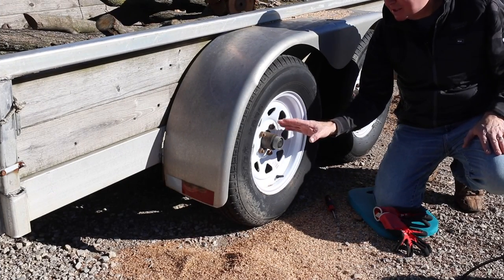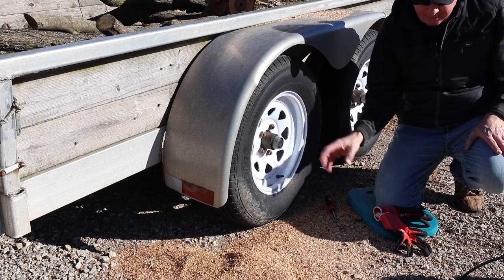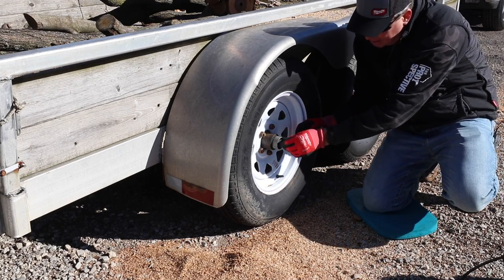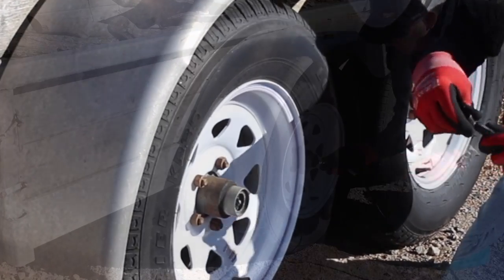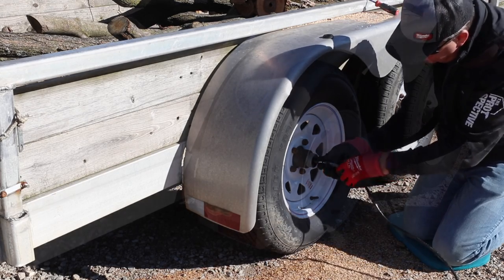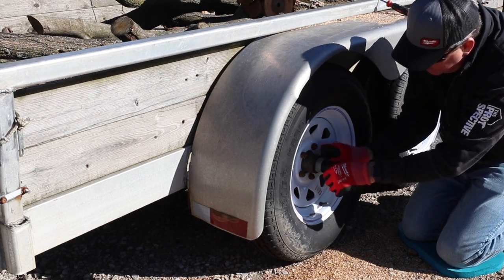When it comes to wheel bearings, I could make a whole video on how to repack the grease or replace them, but this video is just a quick overview of my preventive maintenance. I've owned a few different trailers over the years, and one popular brand is Dexter axles — they have an easy lube hub. This one has a little rubber cap you remove with your fingers or a screwdriver, and right in the center is a grease zerk fitting. Get a grease gun, lock it in, add some grease, and you'll see it spring out a little bit. If you overfill it, you might see grease spray out on your wheels, so just be aware of that — it's as easy as that.